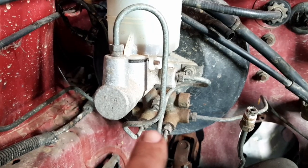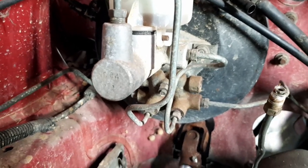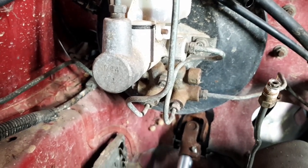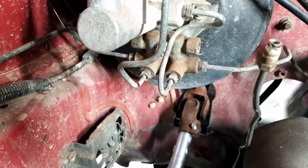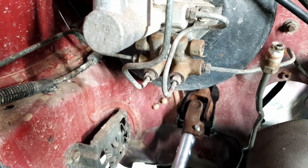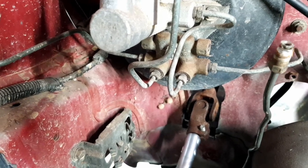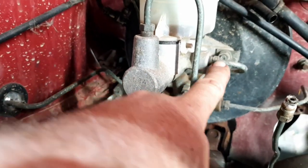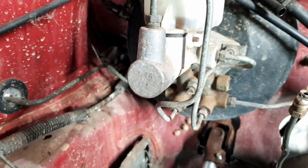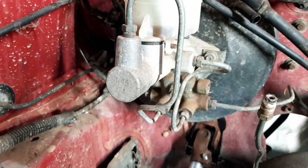That two-in and four-out sort of block, I'm no brake expert, and you know, leave a comment below if you understand how all those proportioning blocks and everything works. It just looks like a manifold to me. So I'm going to remove that manifold, just go straight from this one and straight from this one. So there's only two out on this master cylinder, so hopefully we can get it to work.